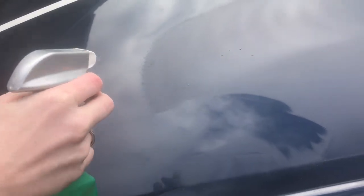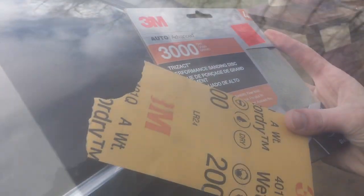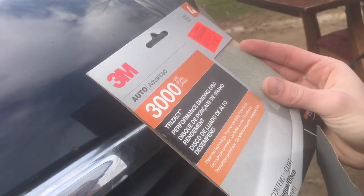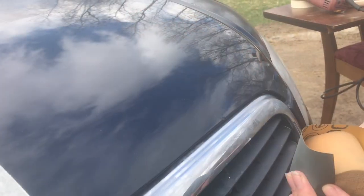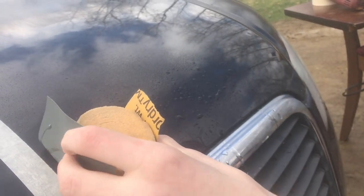I'm going to use a spray bottle with just water in it and spray this down. If you're first starting with a new pad, it likes to absorb more of the compound, so we're going to add a little bit more on the pad. There are little chips in this paint just all over the surface. If we wanted to get this paint more perfect, we'd need to start with around 3,000 grit sandpaper — a real high grit — just to sand and take off the little chips and specks of dust that are embedded. We have some 2,000 grit sandpaper to start with, then we'll move up to 3,000, and then use the buffer to finish off. Put your sandpaper on a foam block, spray down your area with water, spray down your sandpaper, and start sanding.